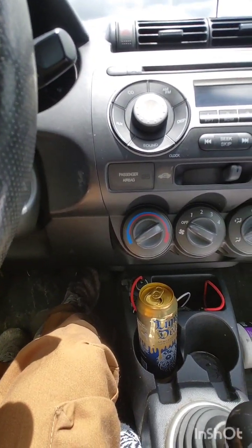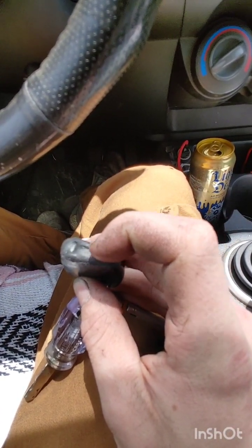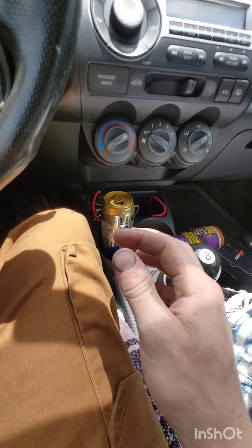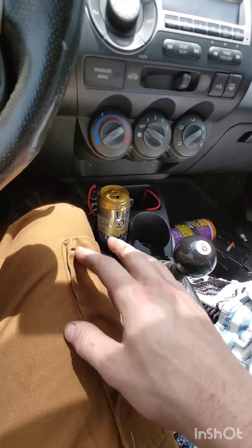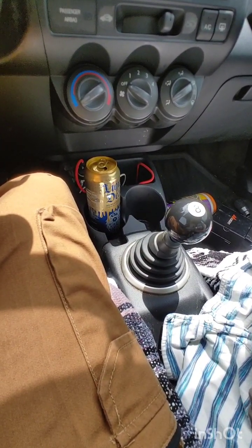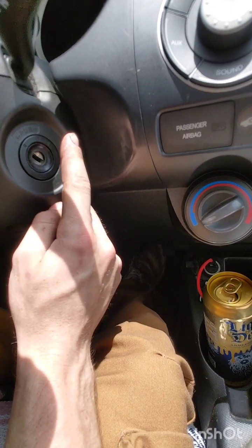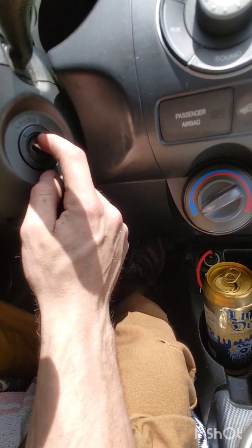What I did was, when I had my transponder out — which it would usually be in a small little pocket right here, my glass one — if it's a later model Honda Fit, it will have a square type one that will either be inside the key plastic section, or you'll just have to see tear-down videos of your key to see what it looks like. I got a piece of butyl rubber, stuck it around the transponder, and then stuck it in certain areas to see where it would go. I stuck it right here on the key, and that seemed to work.